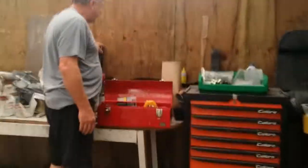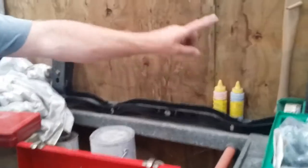In the back here I've cut off the back of the chassis. There's going to be a couple of plates go on here so that the chassis rail can still go back on. The reason I did that is because when I want to take the body off, this roll pan here catches the back of the chassis. So this will be a bolt-on, bolt-off rear chassis member — it only goes back maybe 12 inches. There'll be a couple of plates welded on there and the bolts will go in through there.